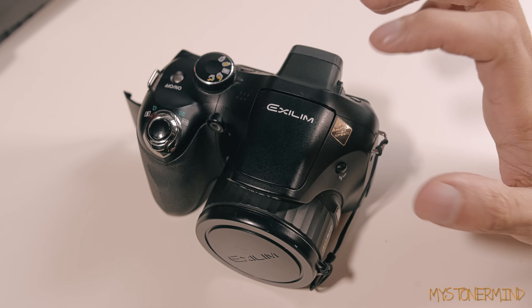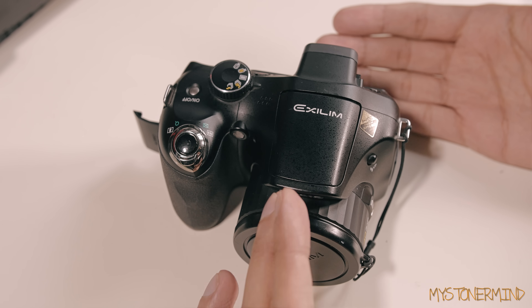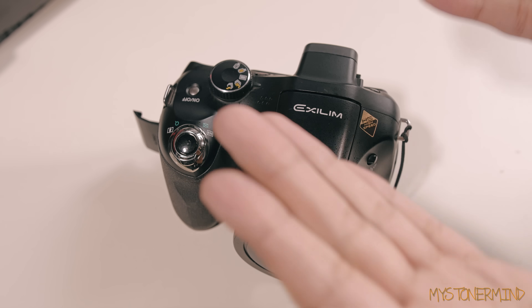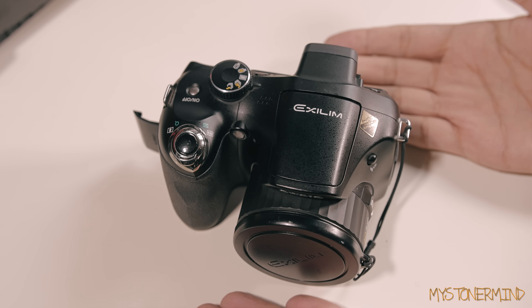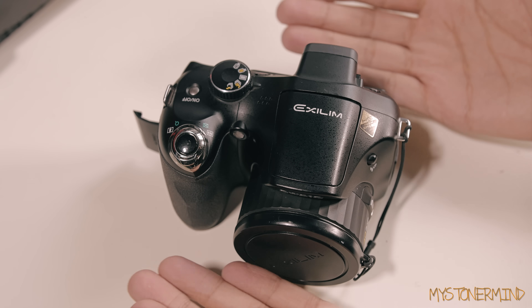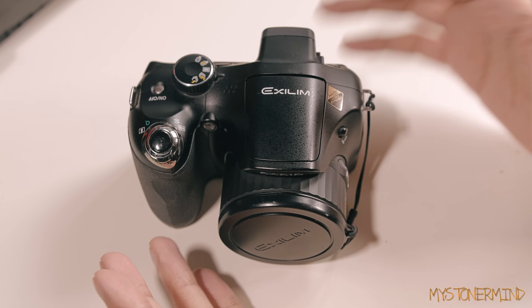What I'm going to be doing is taking out the IR cut filter. What that does is it stops infrared light getting to your sensor and makes your pictures look normal. I'm going to remove it because it's an old camera and I just want to try this as a bit of an experiment, and afterwards hopefully if I'm successful we'll see what the pictures look like.